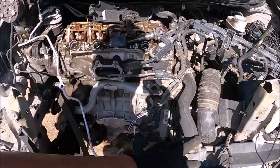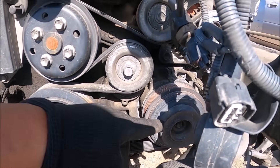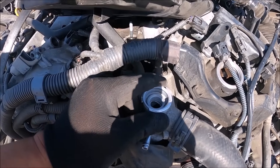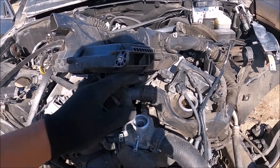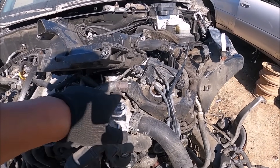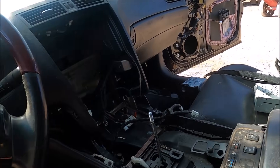Here's the water pump, crankshaft pulley, tensioner, idler, alternator, and AC compressor. To check your water pump: fill up the entire cooling system with water and make sure you get all air bubbles out. Use a two-liter bottle with the top cut off, let it hang at the reservoir, start the engine until the bubbles come out, rev it up, turn the heater on full blast. You can also use a funnel — rev the engine up and down until the water bubbles are gone. Then check if your water pump is circulating.